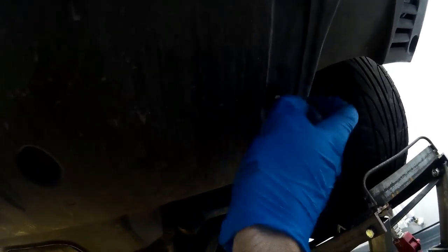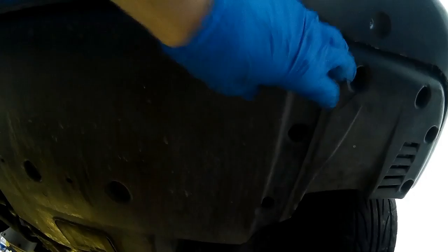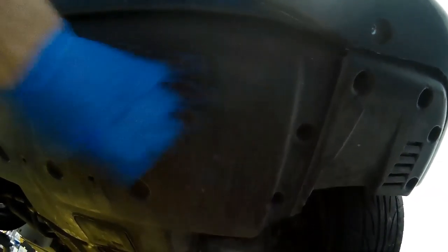You'll also need to unplug the electric fan for the air conditioner and the resistor block for the auxiliary fan at the front. Once you've unplugged them you'll need to go under the car and remove the engine belly tray. Once you're under here it's a case of using a pozi screwdriver to remove six securing screws which hold the belly pan onto the car, and once you've done that you'll be able to get to the radiator drain plug.